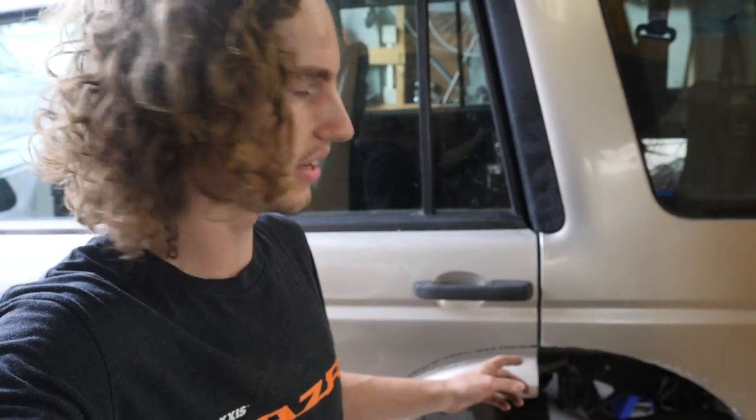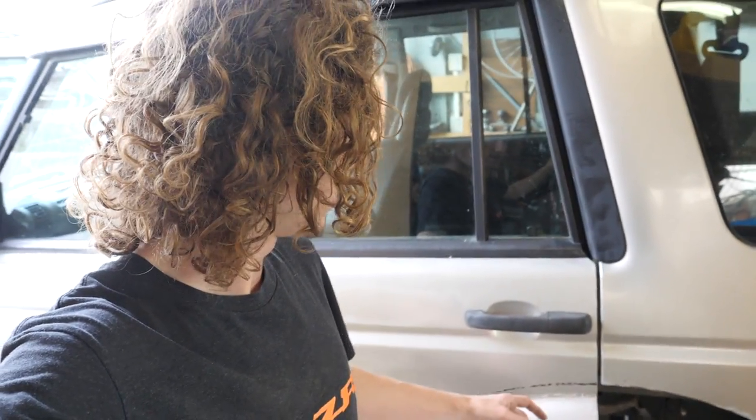So what we're going to do first is cut the outer skin off. Now, I know what I'm doing from the other side as to where I want to cut and whatnot, but again, I want to reiterate, just take your time, only cut a layer at a time. So yeah, just poke the grinder disc through the layer you're doing and no more.